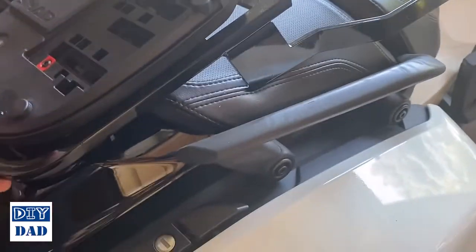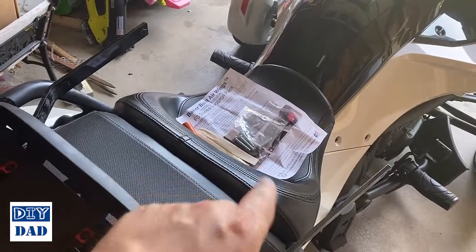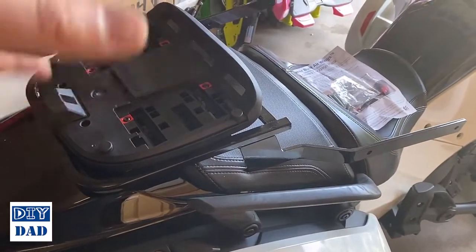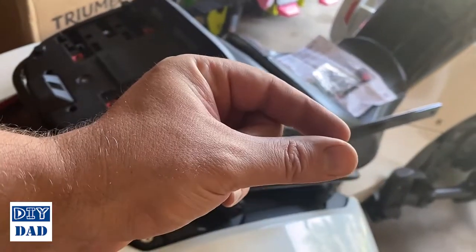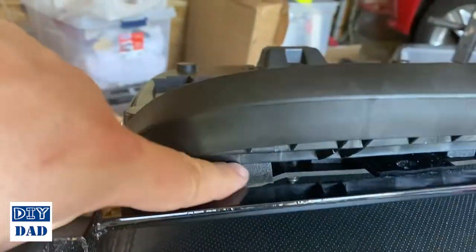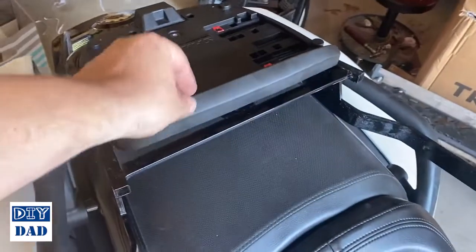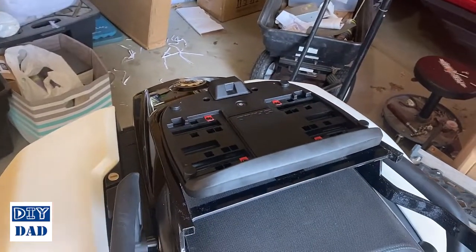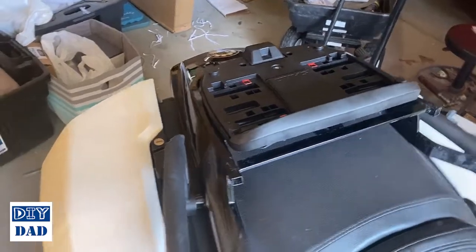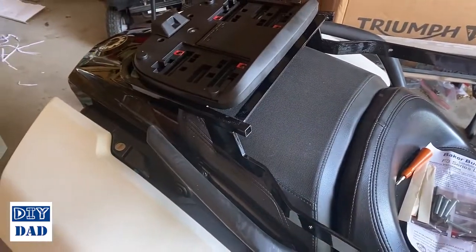To install the rack, we're going to pull these four bolts here — they come out with an Allen wrench. The luggage rack comes with a longer set to accommodate the distance of the spacer plus the metal. I'm not going to add a shim between the two unless it starts vibrating later, and then I'll put a little rubber washer between them. I did throw some foam rubber on the mounting plate — from some insulation I was doing earlier — just to stop any vibration and make sure this is mounted really firm. In my previous Spider with the Givi top case, I had just a little bit of rattle, so I'm trying to tighten that down as much as I can.